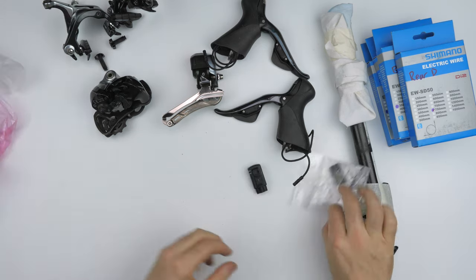A lot of what I'm about to do can be done with this, which is the battery charger, USB. You plug that end, obviously, into your junction box, that end into your PC, and you can do firmware updates and configuration. This can do the same thing, but this connects a little differently. This connects as a device on the Di2 bus. So there are additional cables involved here, and it also has a pass-through if there are no spare ports. But there is a spare port over here that I will connect this to.